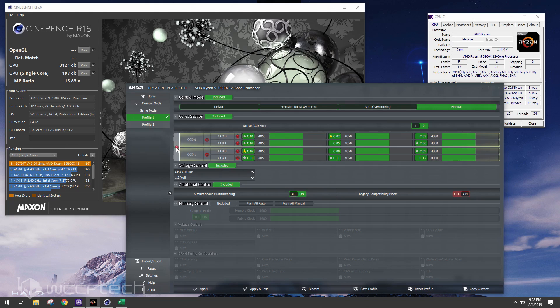You can have cores coupled or decoupled — when decoupled, you can change each one individually. AMD has included in their latest updates the identification of the fastest cores: a gold star for the fastest core of CCX zero on CCD zero, and a gray star for the fastest core of CCX one. You've got your fastest core from each CCX identified across both of them, so you know which ones are most powerful. You can tune your weaker cores down and boost just the two fastest, so under a four-core load you can still get an even better single-core result.